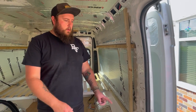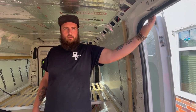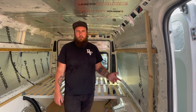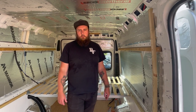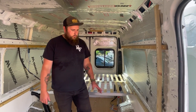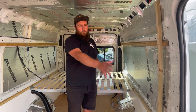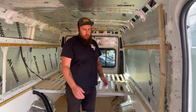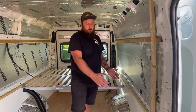We're going to have another switch on the side of the kitchen as you come in — that'll be for the main lights and the pelmet lights. I'm also going to get an outside light which fits just above the door, so that when we're coming in and out we can have a little bit of light and just flick that on without having to put all the interior lights on. As for the rest of the sockets, we're going to have a few on the end of the kitchen, probably a couple on the outer face so we can use them when the doors are open. I also need to get a feed in for the fridge which is going to sit roughly in this area.